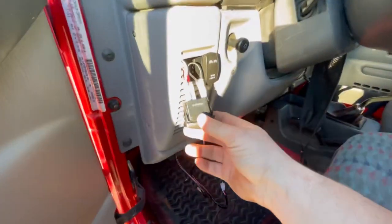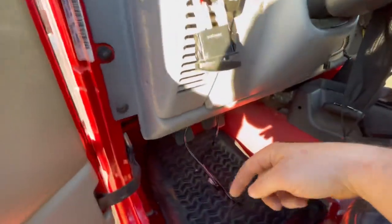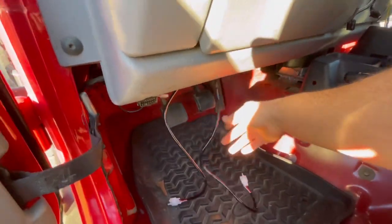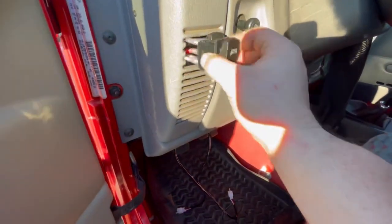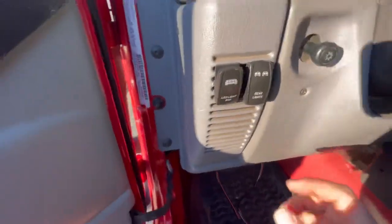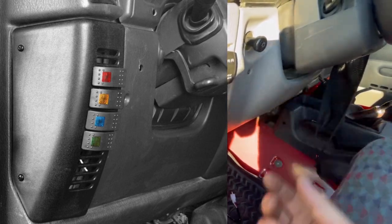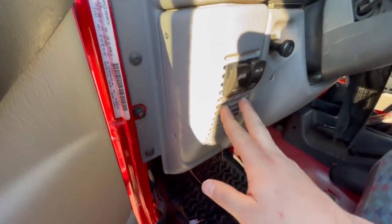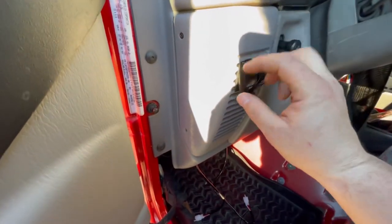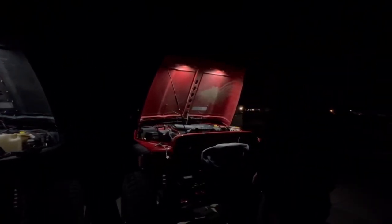For the toggle switches, I cut out three rows out of the speaker cover right here, fed my wires through the back, and both harness cables snap in perfectly. I think it looks pretty cool — you can actually buy this whole cover with four switches on it on Amazon; I'll list the link in the description below. These switches fit perfectly if you cut out those three rows. With the lights on, they actually provide a lot of light on the ground and underneath the hood.